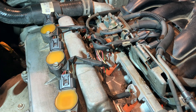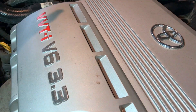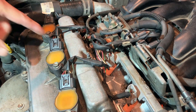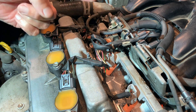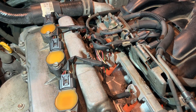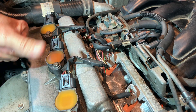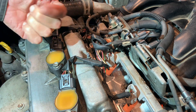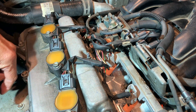I think it's a reasonable assumption that the heat trapped in by this cover led to the deterioration of the plastic — becoming so brittle that it broke apart — which is the difference we saw between the connectors on the front bank and the rear bank. The only difference between the two is that the front ones were covered, but no longer. Unless somebody can give me a good reason to have that cover on, mine is staying off. Up here top left, I'll put a link to the video showing how I replaced these connectors. Thank you.